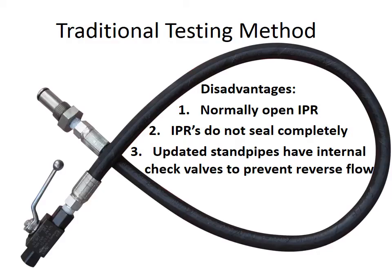The traditional method of locating high pressure oil leaks is to connect shop air to the high pressure oil system by way of an adapter that takes the place of the ICP sensor. This method has a number of problems. The first problem is that because the IPR valve is normally open, you need a scan tool or a dedicated electronic IPR driver to close the IPR. The bi-directional scan tool option can be especially cost prohibitive for owners wishing to make the repairs themselves.